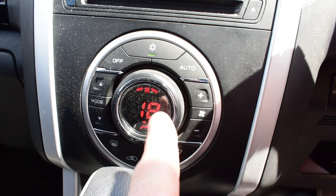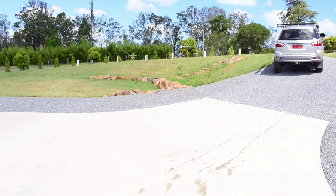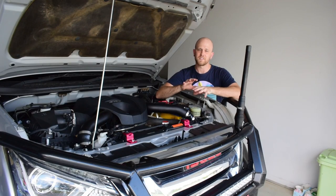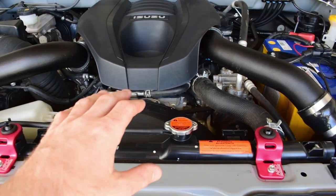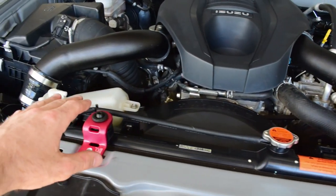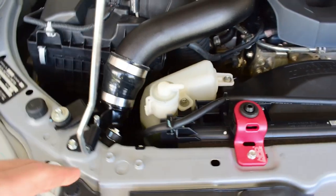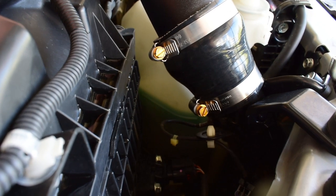You can change your climate control back to cool now and we can go for a drive. Now we've been for a decent 30-minute drive, got the vehicle up to operating temperature, and allowed that new coolant to circulate the system. Now we need to allow the vehicle to sit for up to 4 hours or more and let it cool down completely. Then we can recheck the coolant level safely in the radiator and in the overflow bottle. I've let the vehicle sit for around 4 hours now — the drain bung on the bottom of the radiator looks nice and dry, there are no leaks around the overflow bottle, and the level in the overflow bottle is sitting perfectly on the max mark.